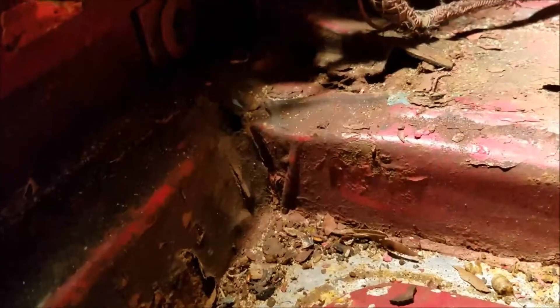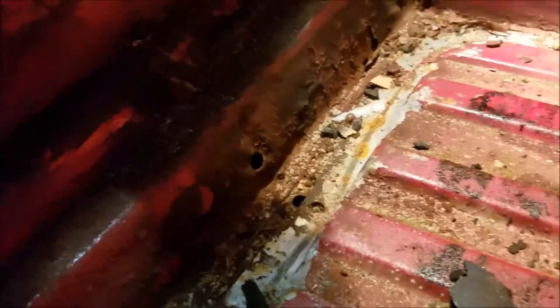I think this thing got a good bang in the back at some point — there's a little buckle there. Somebody had to bend some metal around; you can see they were playing with it. This bottom panel's got some dents that were pulled. This thing definitely had an accident. They didn't replace the rear support, which is interesting — it looks like they replaced the tail panel, but the back support here they just bent back into shape. Not a great job.